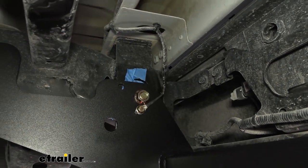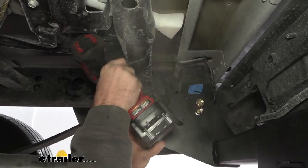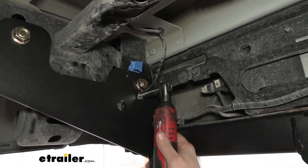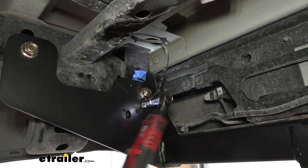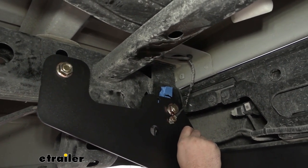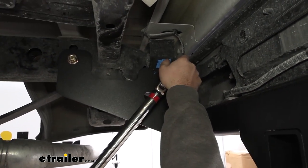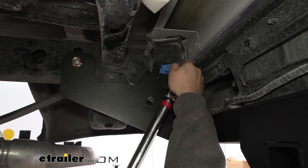Make sure that our hitch is sitting exactly where we want it, and snug all of these down with a 15/16 socket. There's no torque setting I found for the ground bolt, but once you draw it in, make sure it's just snug so it's going to make a proper ground long-term. Then we'll grab our 15/16 socket and put it on our torque wrench — the torque settings are going to be found in the instruction manual. If you need a torque wrench to torque all your bolts down, we have these available here at eTrailer, or you can go to an auto parts store and rent one for free. This is going to make sure long-term that our hitch is going to be tight enough and not become loose.